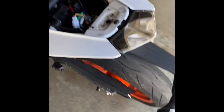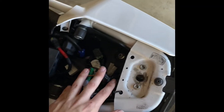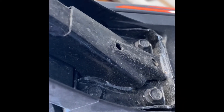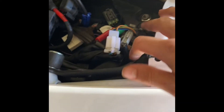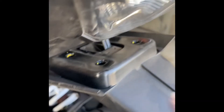It's the next day — I ran out of time yesterday. The next thing to do after replacing the flasher relay up front is to open up the back and remove the tail fender, or tail tidy, whatever you want to call it. There are four bolts at the bottom — all four are 10 millimeters. The two bolts further up do not need to be removed; they bolt to the subframe.